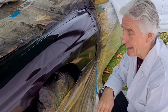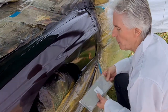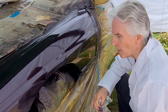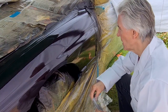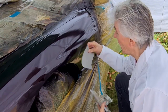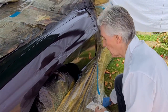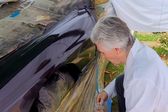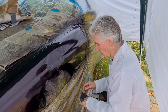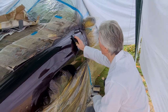So my plan today is to wet sand it. What I think I'd do is start with 1500 grit and see how that comes on, and see if I can get rid of these slightly drippy places. So we'll see how it goes. We've got 3000, yes. It'll take me a month of Sundays to cut anything with that, that's for sure. Righty ho, let's see what happens. Always exciting.